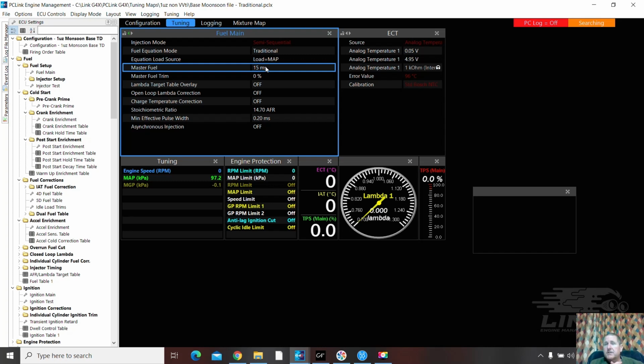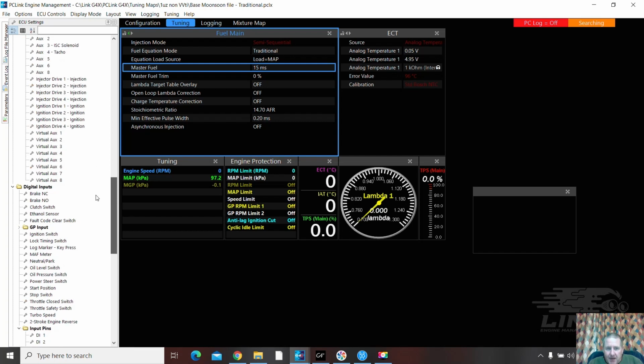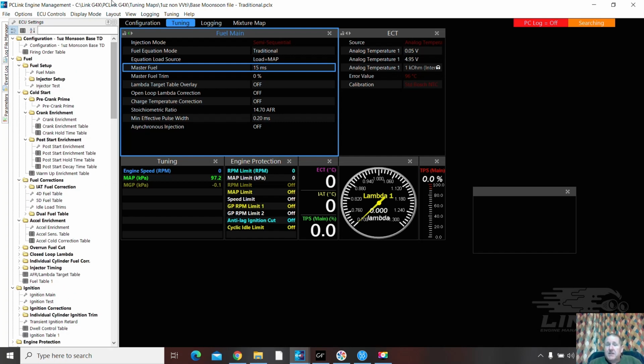If the idle speed control unit isn't working initially, don't stress. Probably just unplug it, warm it up, keep it running. Once it's warm, set a base idle of 700, 750. Then plug in the idle speed and set up some idle speed. There's other videos on that. We've babbled enough for tonight. So I hope that's been helpful. I'm sure there's going to be questions, but that is actually a whole setup. That has taken me nearly an hour to go through this, and that is a very fast setup.